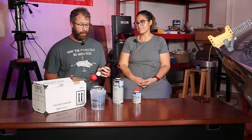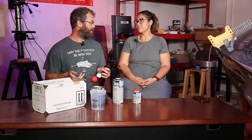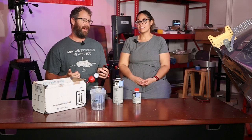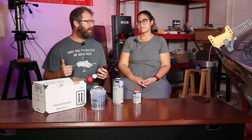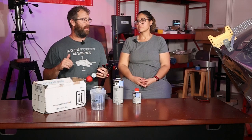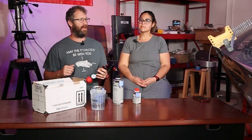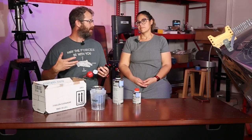So now all we have left to do is a little prep work, right? Like about 5-10 minutes worth. A lot of prep work. Starting tomorrow night, which is Friday, Saturday is going to be all day full-blown prep work. Going to scuff everything, whether it's primed or not. We're going to really take care of scuffing any bare aluminum that's in there. We will degrease, clean, wash. As soon as we start the degreasing process, we're going to switch to gloves only, so we're not going to touch anything inside.